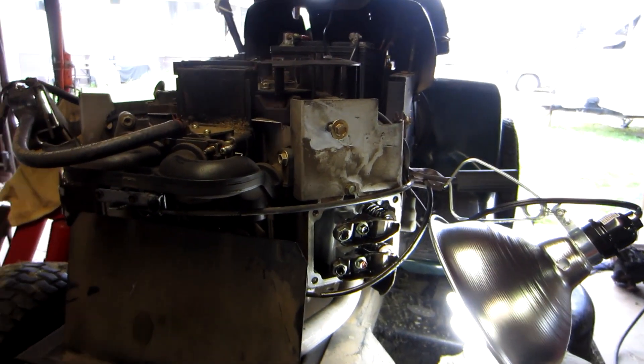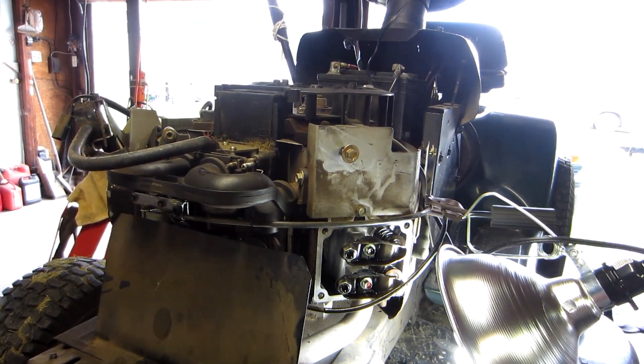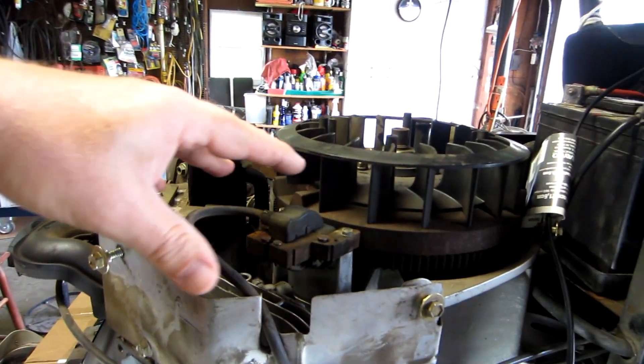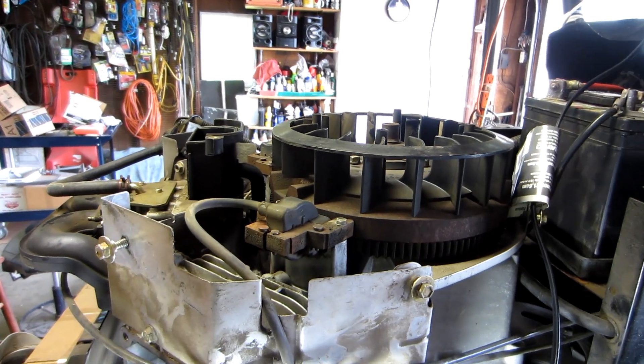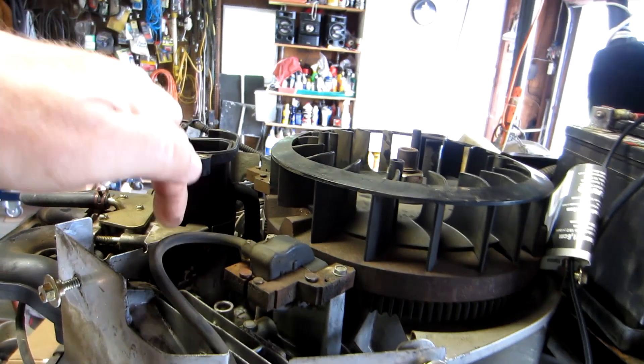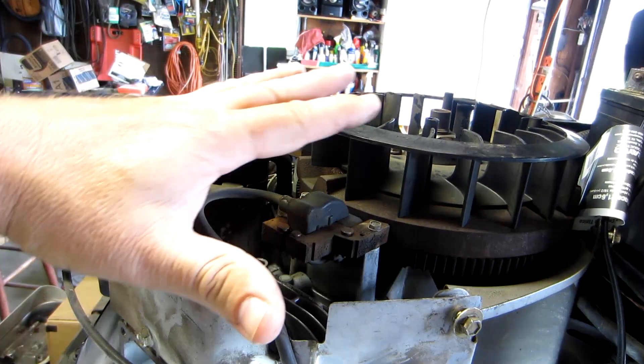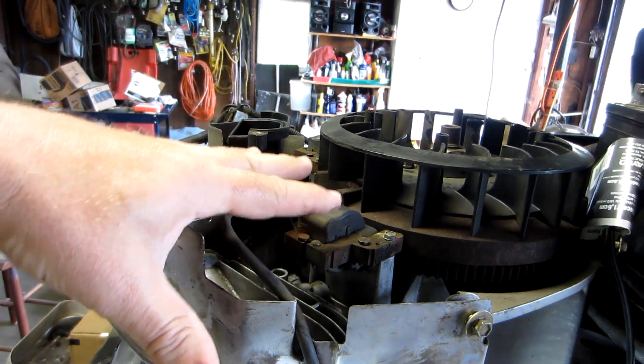Usually on these, it's the same thing — they overheat. Whether there's too much debris, especially if you live in the north and over the winter mice have made nests up in there, or if you mow in an area with a lot of dust and debris, the cooling fins get blocked up. The blower housing directs air over the fins to keep the engine cool. If you run low on oil, don't change your oil often, or have debris and mice nests on top, you can expect either a busted connecting rod or something like this — a valve guide that comes out of the head. That's what happened in this case.